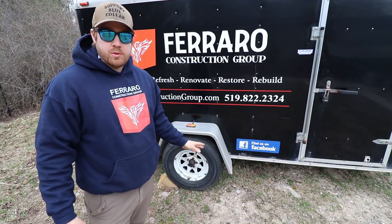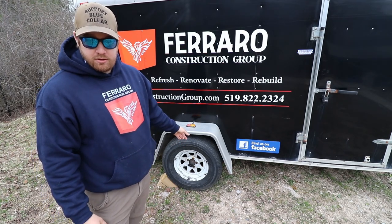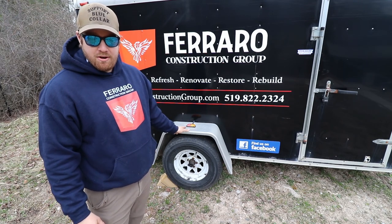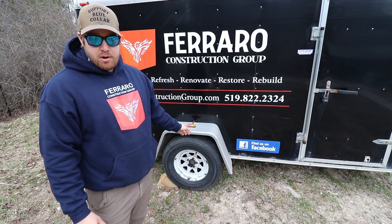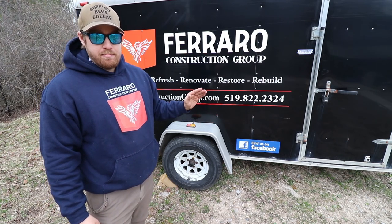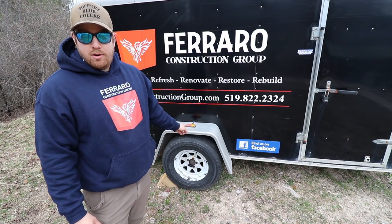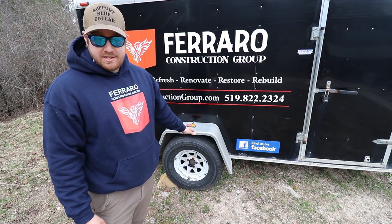As for wheels, almost all these trailers come with really cheap steel wheels. You get your choice of black, white, or silver steel — some manufacturers offer an upgraded wheel, but I think that's ridiculous to pay for on a utility trailer. The tires, though, are worth upgrading. Burn out the ones it comes with — they'll go quick. When you replace them, get a better tire with a proper ply rating, because the last thing you want is a blowout on the highway causing an accident.